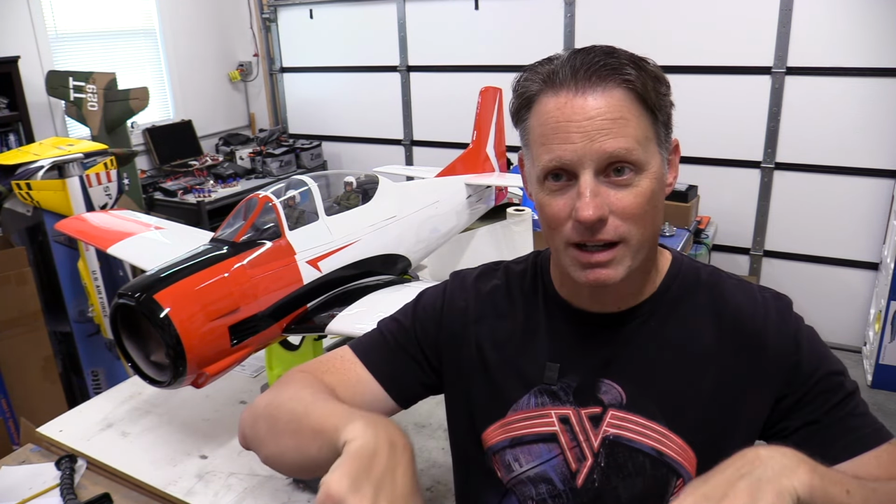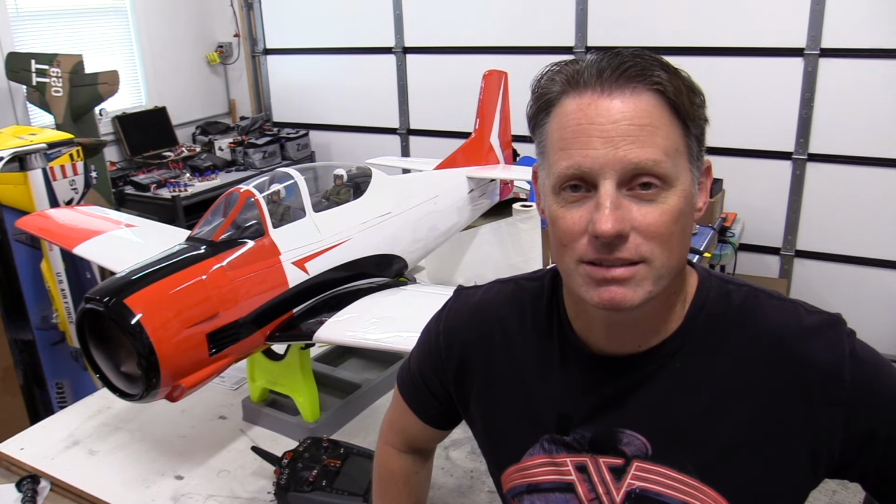Setting up an air system, again, is not hard, but you just gotta make sure you follow the instructions, right? You have to have T fittings because you gotta connect things up in parallel. So you have to have T fittings to split off so you've got enough airline to go to the wings and to the nose, right? And so it's just important to understand that you have to have those T's in there, and you're partitioning off lines so you make sure that everything is connected properly.